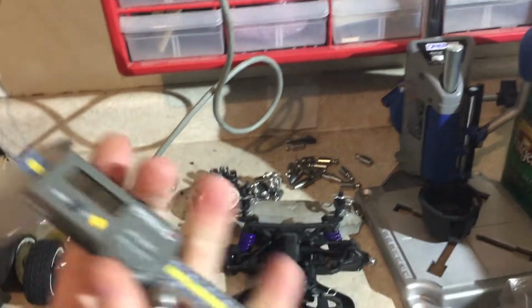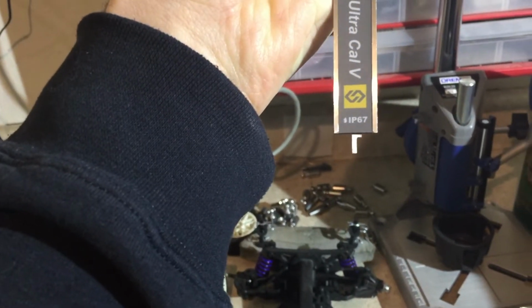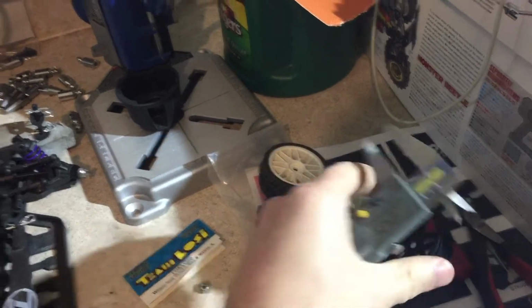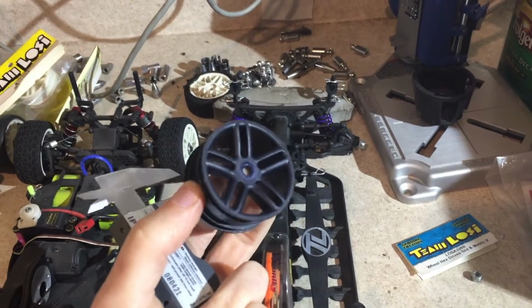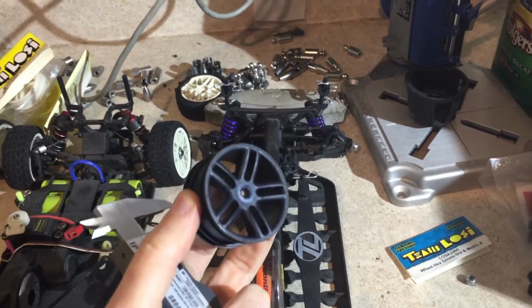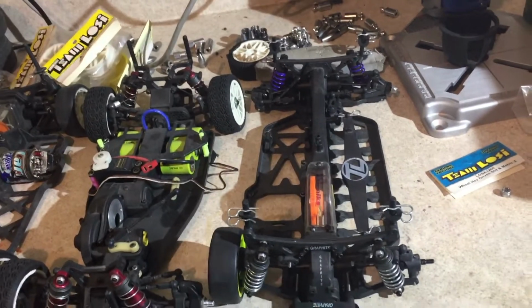I don't really have the right tool for doing it, but using the end of the calipers and trying to eyeball the level where the hex starts out to the outer side of the rim on both the ones with the extra offset and the old standard Street Weapon ones, it looks to be about 0.050 inches, round in there somewhere, of extra offset. Not a whole lot, but definitely, as you can see from the results in the earlier stuff, it's enough to get the clearance you need.